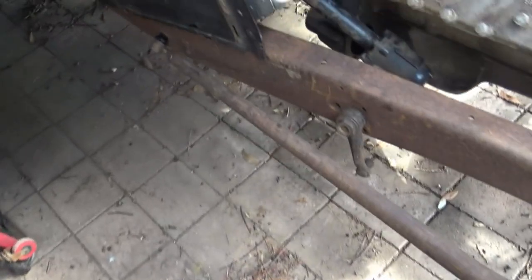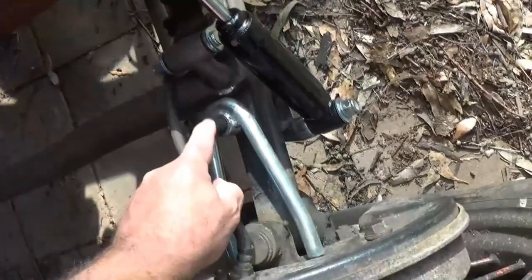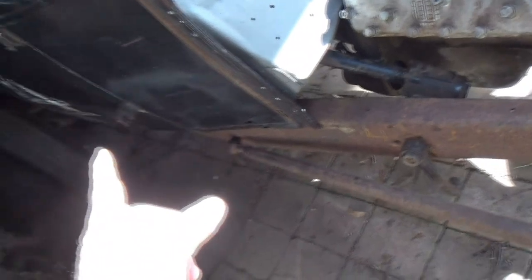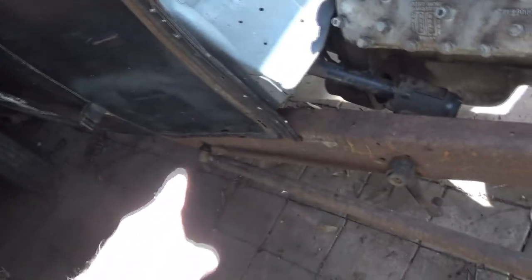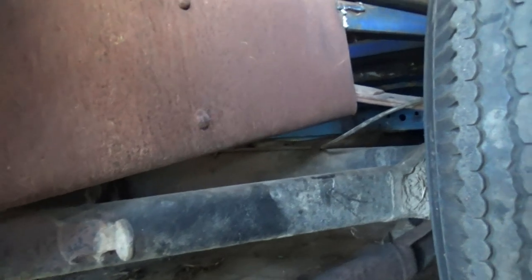By redesign I mean put back to more standard. With my wishbones mounted to the chassis on the side here, it gets in the way of my steering. The steer ball is on this side and it's got to jump over and get onto that side. I've seen guys use bent drag links but I don't want to do that. The way to fix it is by mounting that underneath, so I'm going to modify the cross member to handle the stresses of the front end and mount those to the new cross member — that'll give me a straight line of access for my steering.